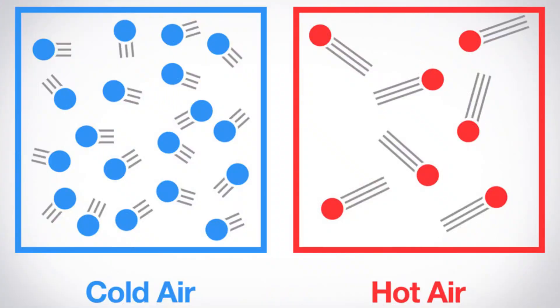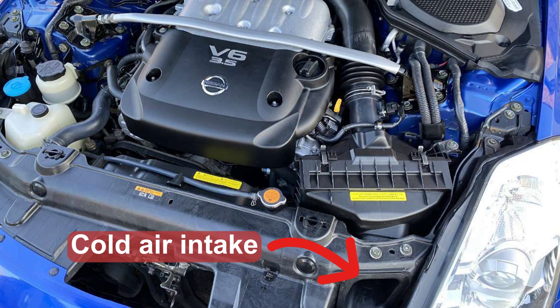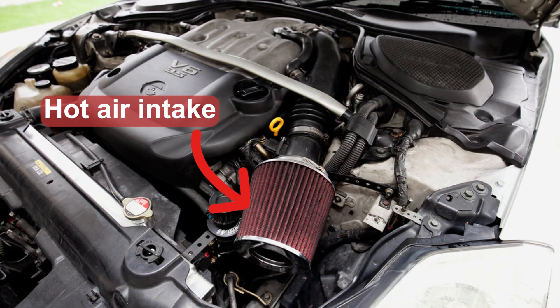The problem is that the engine needs cold air to work properly. It can work with hot air, but when the engine sucks in hot air there is significantly less oxygen in that air, so the amount needed for proper combustion increases in comparison with colder air. The standard resonator box air filtering system will have a certain cold air intake and will not take in heated air from the engine compartment. This is why open cone filters may eventually downgrade engine performance.